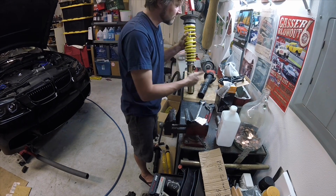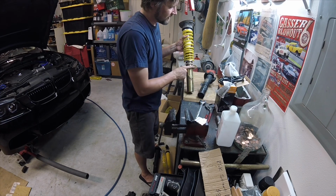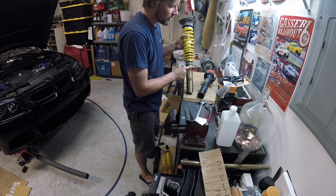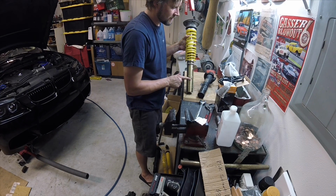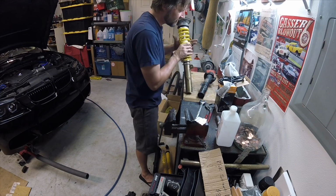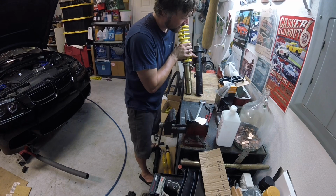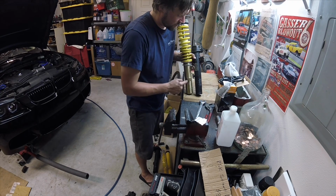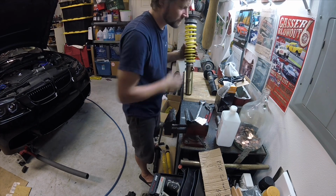There is a difference between the left and the right struts. And what it is, is this mount bracket for your sway bar end link in relation to this locating tongue or the rivets. So you can figure it out visually. There's the two rivets and there's the sway bar end link tab. And we're lined up. If you switch them, it's not going to work.